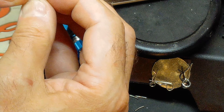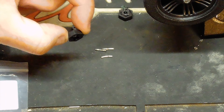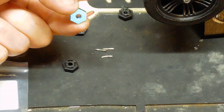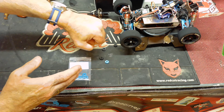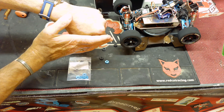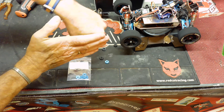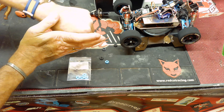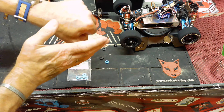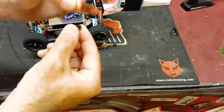Because the plastic hex was getting crushed as it was screwed in, it was acting as a brake. My simple fix: replace them with nine dollar aluminum ones. Think of my fist as the rear stub axle carrier and my hand as the hex — as we tighten the wheel nut, the plastic hex gets closer and closer to the hub, forcing itself around it and acting as a disc brake. The harder I tightened the wheels up, the more I was actually increasing the problem.